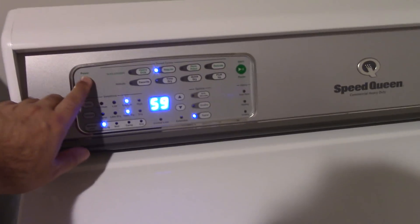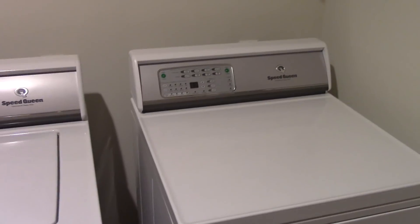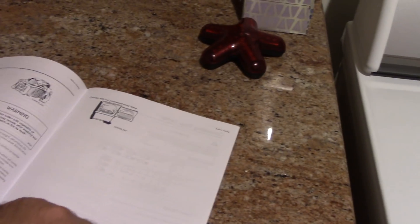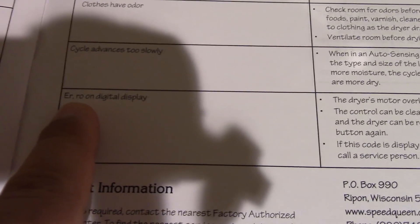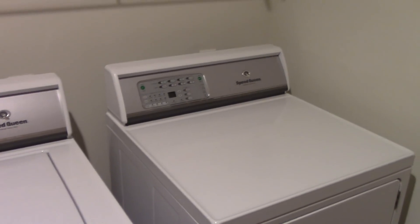As expected, I went onto Google and searched as much as I could — Speed Queen dryer ERCO error code — and I couldn't find anything. Even in the owner's manual, the only error code it tells you about is E-R-R-O, which means the motor's thermal overload has tripped. There is nothing in the owner's manual that will tell you about the error code E-R-C-O.